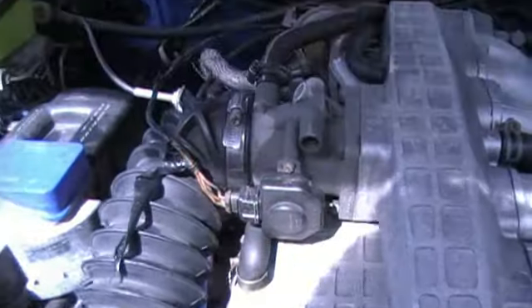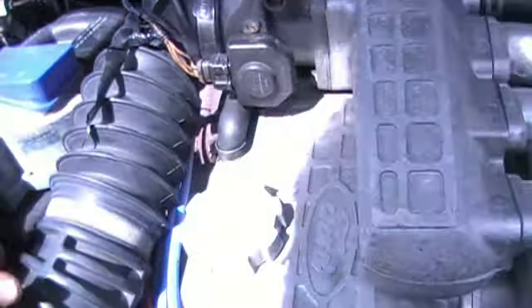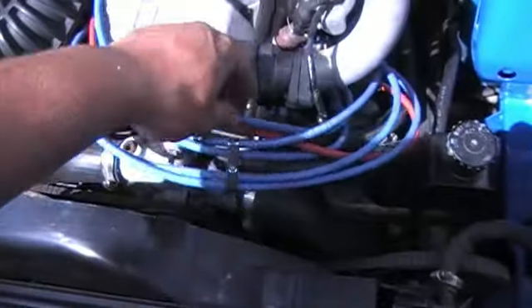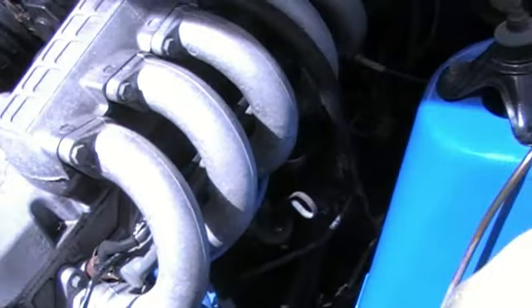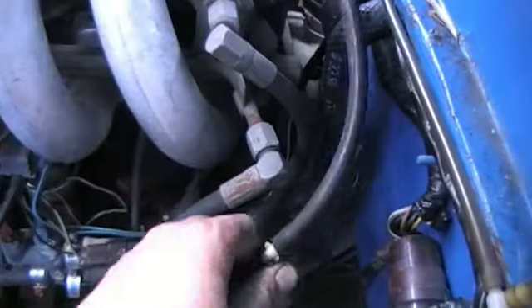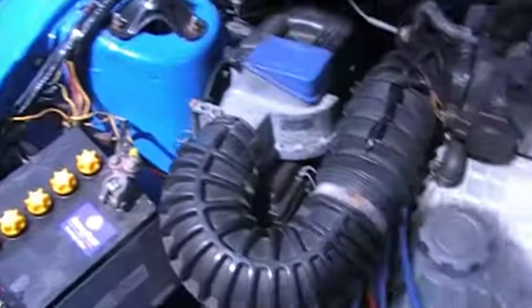I've been having a little bit of trouble with this — it's running like it's got a flat spot at low RPM. Since I bought it, I've changed the leads except for one because I had a spare set laying around, I've changed the cap, I've changed the coil down there thinking that might be causing it, and found a load of vacuum leaks that were all around here and I'm trying to fix all of those.